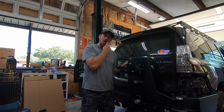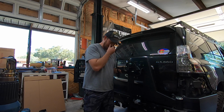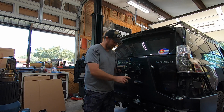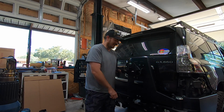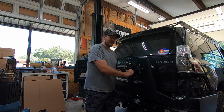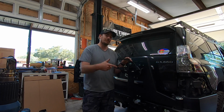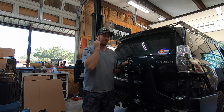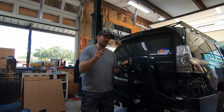1.5. So I'm going to have to find some, hopefully there is either spline lug nuts, which I know they're out there. We can go get them from our local Discount Tire or whatever. But the problem there is then he's got to keep two different kinds of spline keys. And if you don't have different kinds of lug nuts and they're just the wrong thread pitch, when you're changing your spare over, you might pick up the wrong one and try to jam on the wrong lug nut and never be able to get one wheel off without having problems. And I'm not here to make more problems for you people. I'm here to solve problems for you people.